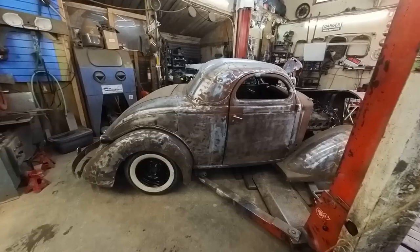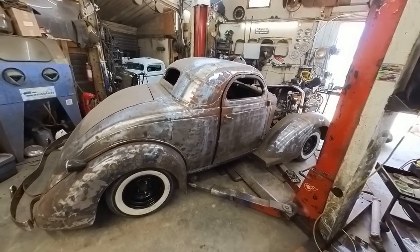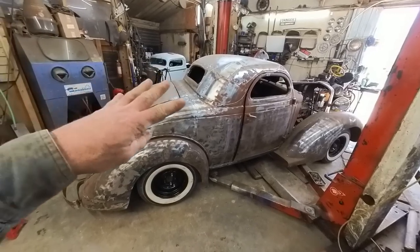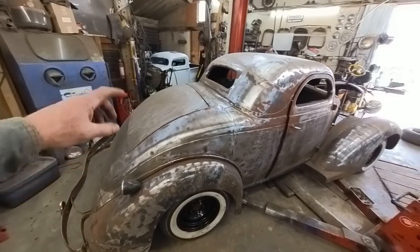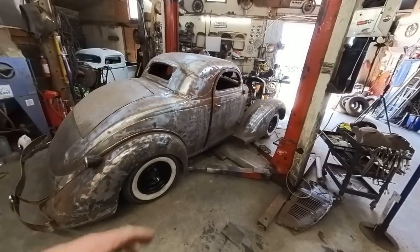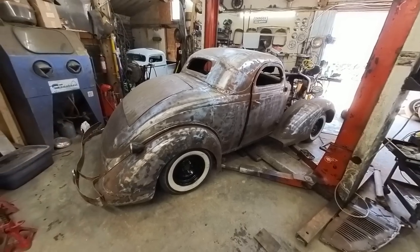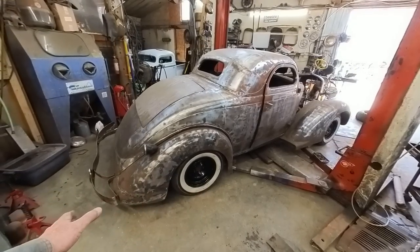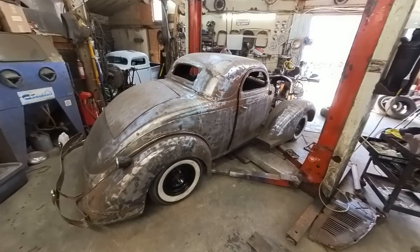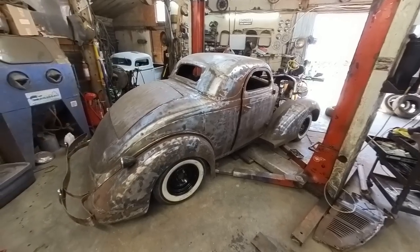The chances of getting a flat tire, blowing all the airbags, or two of them, are slim, because you got to remember, I do a four-wheel system, so even if one side lost air, the car would still look pretty close to the same. It might sit a little goofy, and if you lost the bag on one side, it would be kind of chaotic, but there's nothing below the scrub line, so the car would probably sit okay. It would handle kind of junky, but that's just what it is.